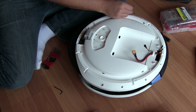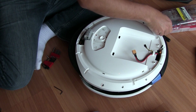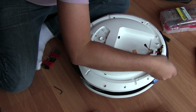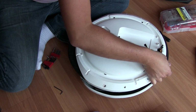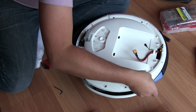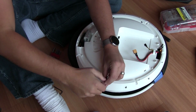It's not as if you've got the luxury of some extra additional space. That tire that's on that rim is really tightly mounted, and you're going to need some form of levers, like tire levers, preferably plastic tire levers, because without that, I doubt you're going to get this tire off. I know people have resorted to using a butter knife or a flathead screwdriver, but ultimately you run the risk of puncturing the tire and then puncturing the tube when you put it all back together again. So you're not going to want to do that, and it kind of defeats the purpose of the repair.